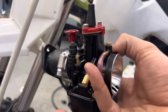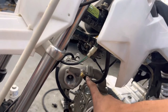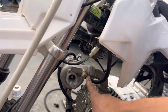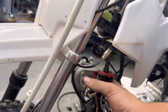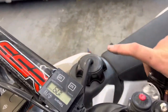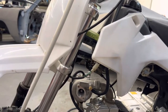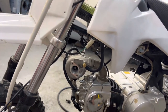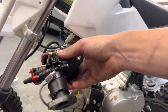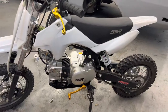Another reason I chose this carburetor is that I'm able to pressurize the fuel bowl. I took this from another video — normally you could put a boost gauge here, but this is a great vacuum source, so I'm going to put a tee in here to tee it off to whichever side I choose. You also pressurize the gas tank up here with the cap, which gives you fantastic fuel pressure. Normally for a turbocharged application like my Camaro, an electric fuel pump is a lot more consistent, but you can't really run an electric fuel pump on this — well, you could, but it'd be a pain. So this is my solution.